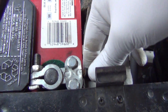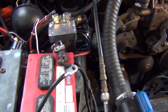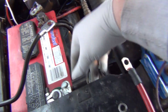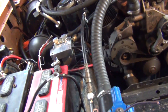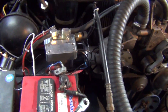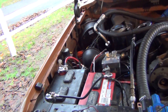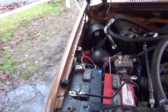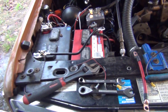I'm also flipping the plates around so they bite into the posts better. Based on how cheap having the cables made up was, I'm probably going to go back to Napa and have them make me new power wire in a thicker gauge, same thing with the ground — so I'll have two new cables with a permanent end. This is more of a progress update type of video than a how-to.